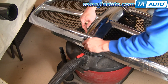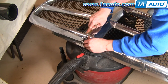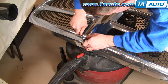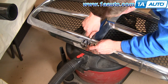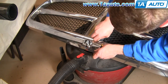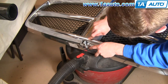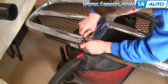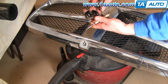I'm going to get the RAM logo off using a really small, sharp screwdriver. You'll notice I go in there with two screwdrivers — that's because there's the outside chrome ring and then the black part inside is somewhat a different piece. With one screwdriver you want to start the outer chrome piece, and then with the other screwdriver you reach in there and get that black part of the emblem as well. You don't want to pry too hard on the chrome ring — you want to get in there underneath the black before you really start prying. So there are two parts you have to get: the chrome ring around the outside, and then you have to pry in underneath and get the black part as well.